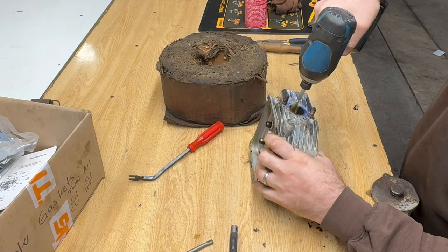So yeah, use torque wrenches for all the really important stuff: connecting rod bolts, sump plates, head gaskets. The rest of the stuff, if you work on this long enough, you know the thickness of the bolt and what exactly it's going into, say aluminum, you get a feel. When I was torquing those rockers down, I knew something wasn't right. Something did not click right in my head or in the torque wrench.